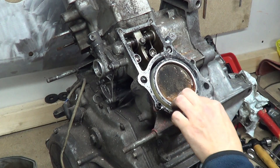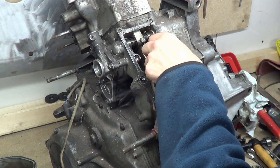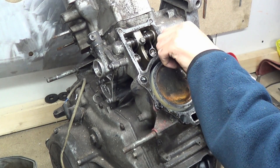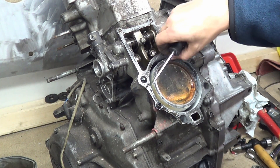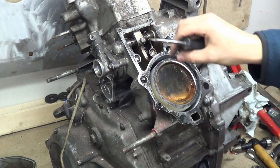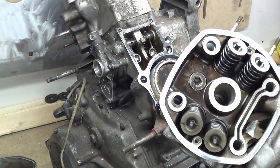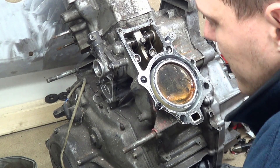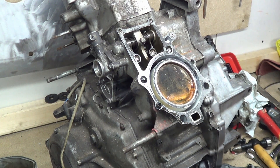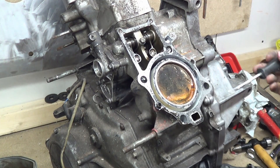Piston wires. I didn't try to see if it would turn over, and it's a good thing I didn't. This is the reason why I don't try and turn engines over when I know nothing about them, especially if I'm going to pull them apart. That's nicely seized. What has happened is water has probably gotten through the spark plug. The actual cylinder head in here is fine - there's no water, no mayonnaise, no horrible white stuff - but in here it's nicely soaked.